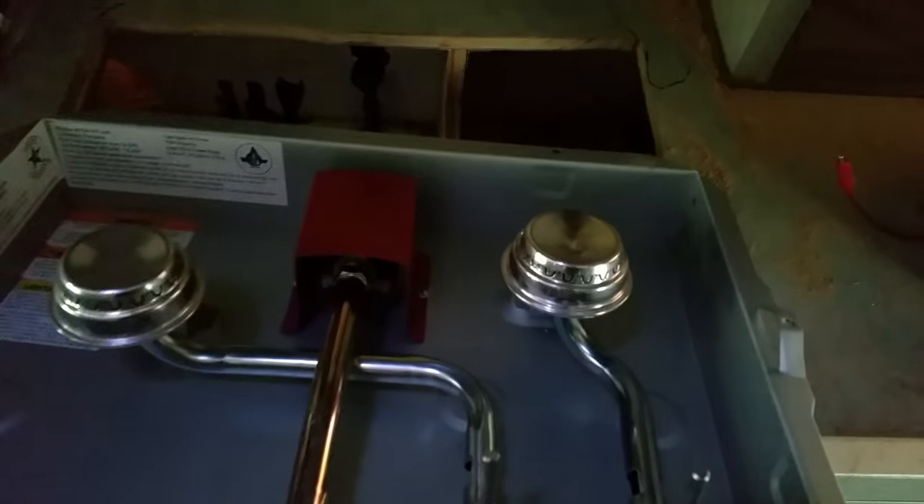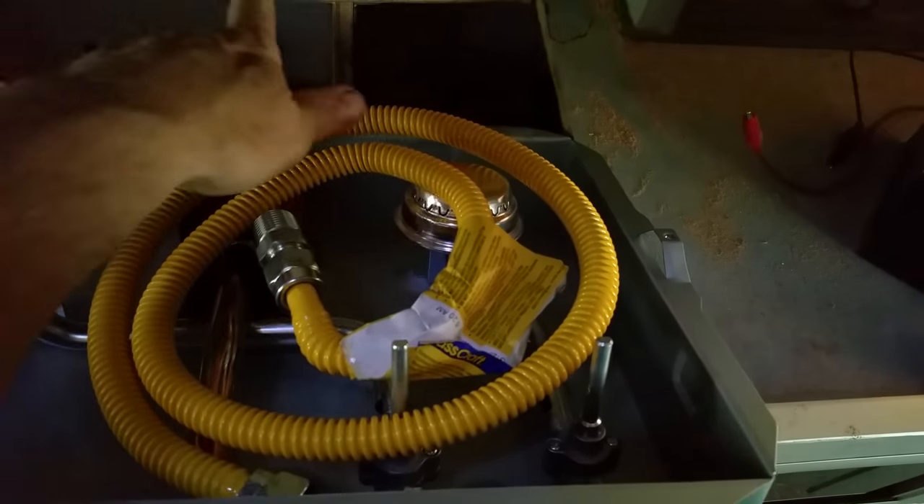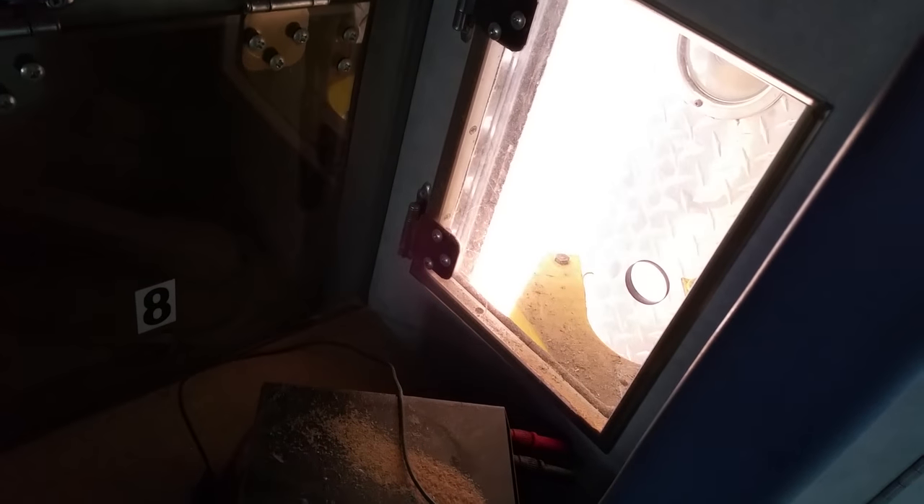I hatcheted the divider out of the compartment and I'm going to drill a hole for the gas line. I've got a four-foot gas line I'm going to run through the back of that cabinet, angle it between the space between the cabinet and the outer wall, and into the O2 compartment. I was able to get the gas line ran back to this compartment, and fortunately where the oxygen tank hose came in I was able to feed that through into the extra compartment - the hole was already pre-drilled.